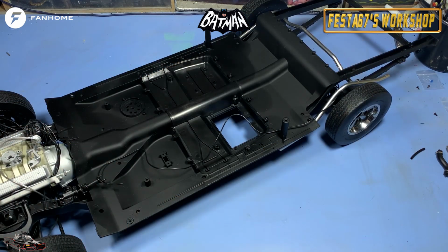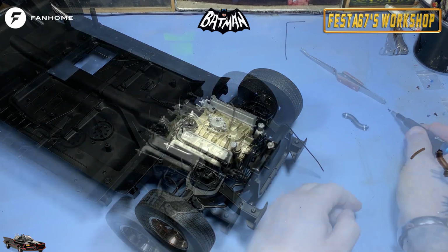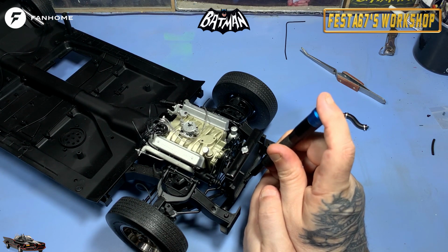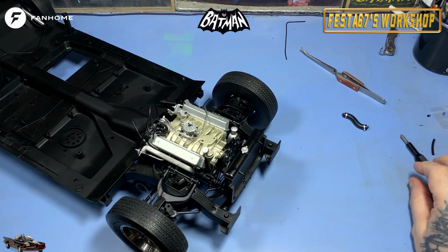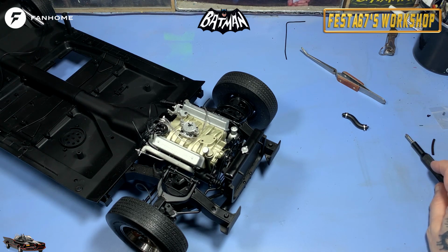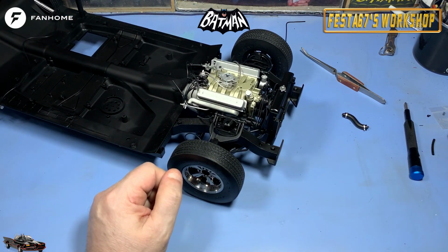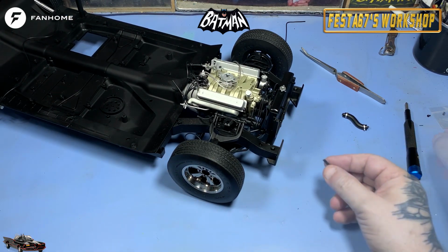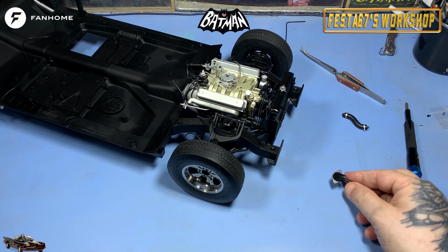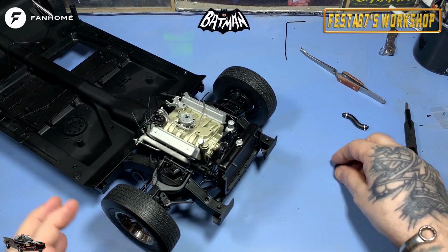Okay. 2AM screws to go in the front of there, folks. Okay. So let's try and get them in. Put that other screw in the front of there. That's that done. We've then got to push the water bypass upper tube onto there, like so, on the thermostat. And then that goes in the top of there.